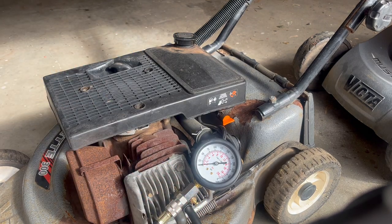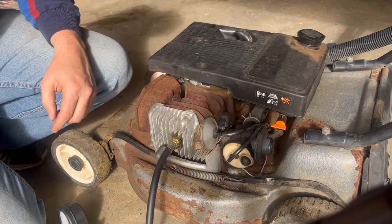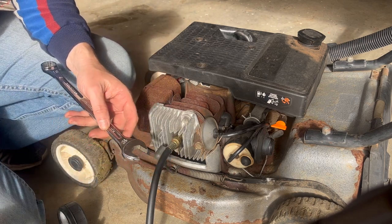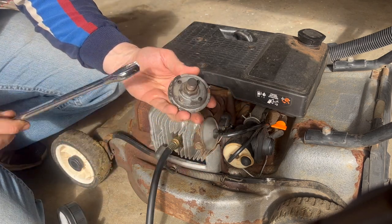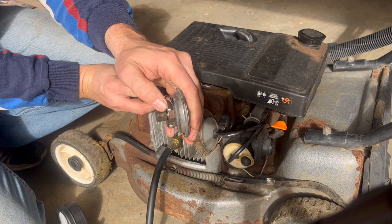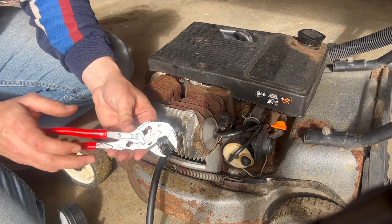Now let's see what happens if we take the decompressor out. To take the decompressor off, you're going to want to remove that vacuum line to the carburetor. Technically you would use a 19mm spanner; however, as you can see, my spanner is simply too fat to get in there. But if I show you with this spare decompressor I've got lying around, you can see it is actually the correct size spanner — but the thickness of my spanner is wider than the nut on the decompressor.